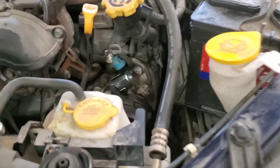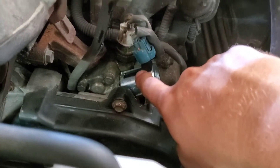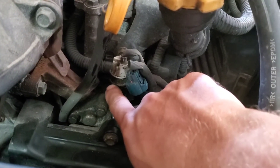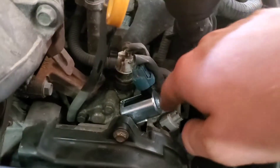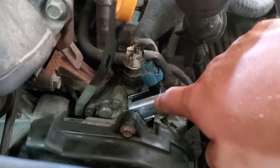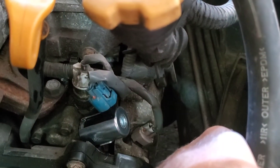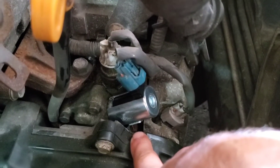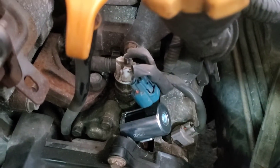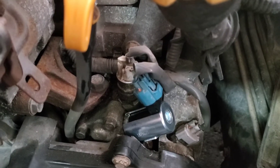With the car off, you've got your VVT solenoid right there, and then that's going to be your oil pressure switch. You can test the VVT solenoid here — I went ahead and just replaced it. They're pretty easy to replace. All you've got to do is pull this connector off down here. There's one bolt. You can pop this bracket off and there's one bolt — you can kind of see it right down through there and just pop it out. I went ahead and replaced it as a safety measure, but that still did not fix my issue.